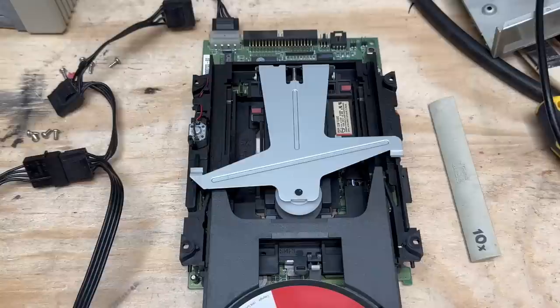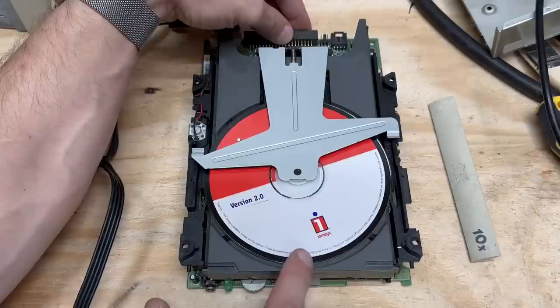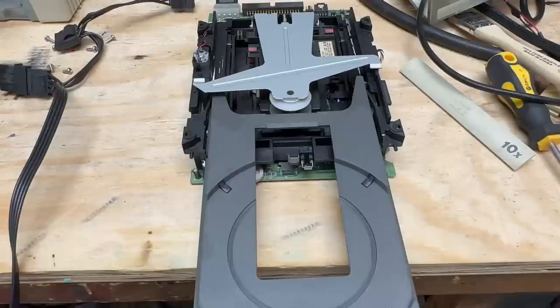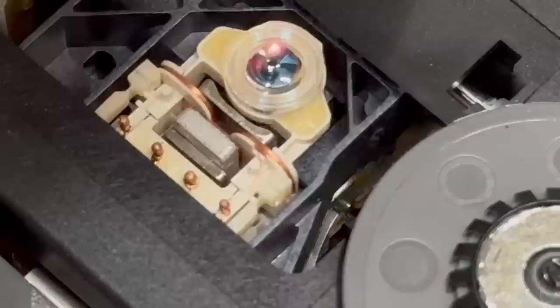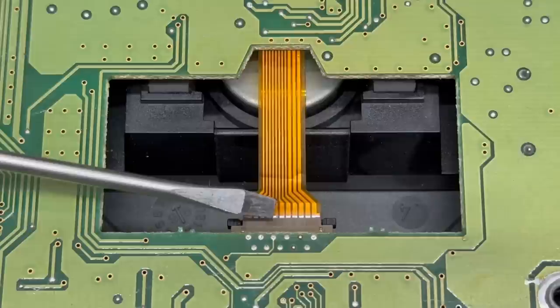Got it opened up. So we're not spinning the disk — I do hear the laser. We might just have a bad spindle motor. This is a cool old drive, so I'd really like to save it. The laser lens doesn't look very dirty, but let's try cleaning it. Still no spin. I went ahead and greased up the CD tray mechanism. Let's check out the spindle motor — this is the flex for it, and I noticed it had a little crease here, but I checked continuity and everything's good. I do get voltage readings from the board side and resistance readings from the motor side, so not quite sure what's going on.